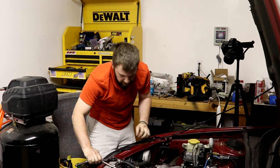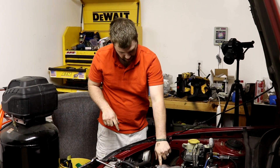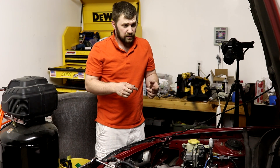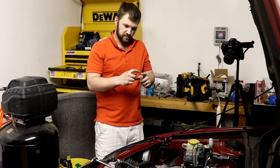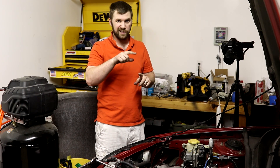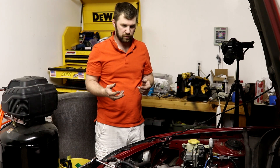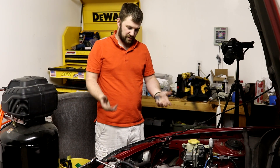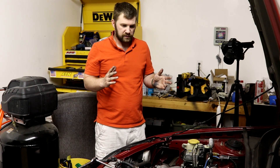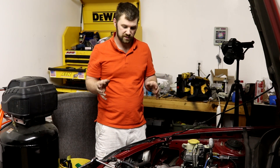If this doesn't fix your code, there are a few possible causes. One is the oil fittings on top of the hard line going down into the AVCS solenoid — from the factory they have banjo bolt screens in them. Subaru actually sent out a bulletin saying you should remove those screens because all they're doing is clogging your AVCS system. A restriction of oil flow or a bad solenoid basically causes your timing to do strange things when you don't want it to.